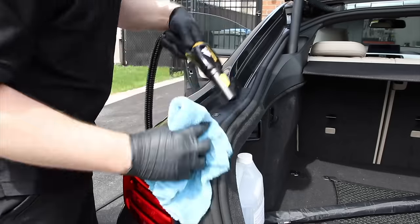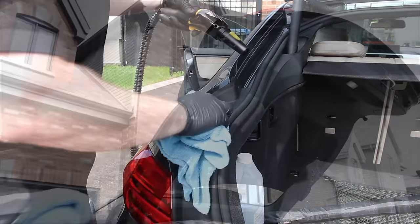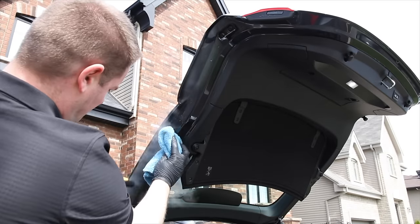Once you're done with the door jams and door sills, don't forget your trunk jams as well — any area where you open and close doors requires attention. You can also use a steam cleaner on trunk jams, door jams, and door sills: steam the surface and wipe away. In your steam cleaner you can add half an ounce to about one ounce of a rinseless wash like ONR to bump up the cleaning potential. Always use distilled water in your steam cleaner tanks.